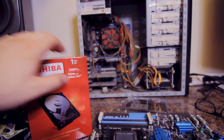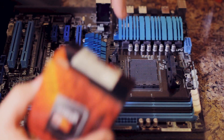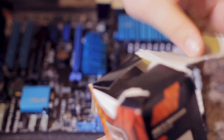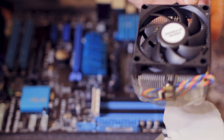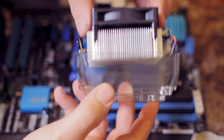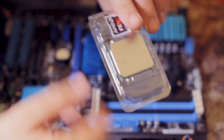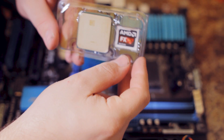Usually your very first order of business is to get your new CPU on your motherboard. There is the new chip - got ourselves a little AMD. You've got to open the socket, find the little alignment arrow in the corner, and match it up. You can tell by the little spots that are missing. Drop this bad boy right in there - and that just dropped right in there. That went in too easy, now I'm suspicious it's not going to work at all.